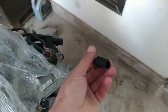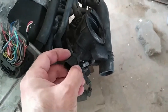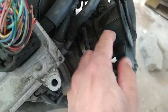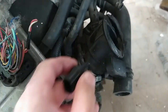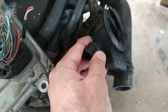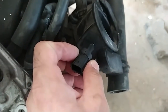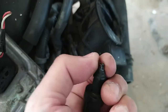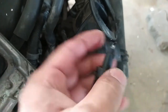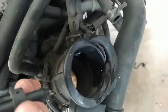When you add a separate intake temperature sensor, you will have to make something to fit it — make a small hole and insert it there. But if you are turbo, there will be positive pressure inside and it will pop out. So if you are turbo, apply some epoxy or a zip tie so that it stays plugged in. That covers the separate IAT sensor.